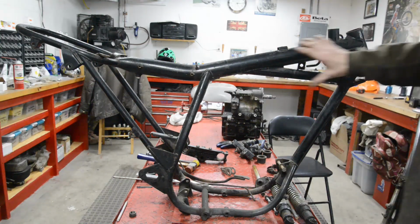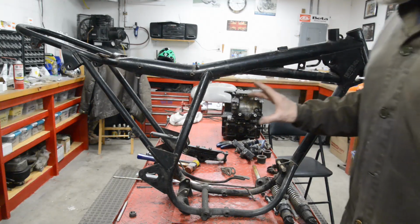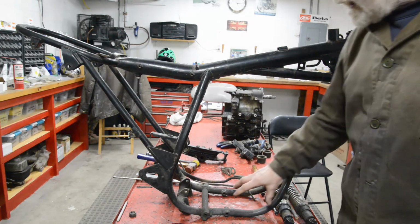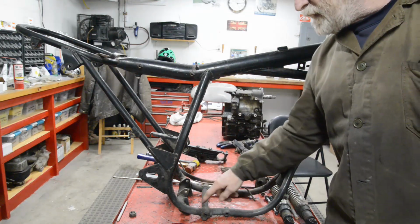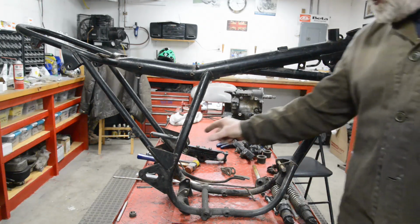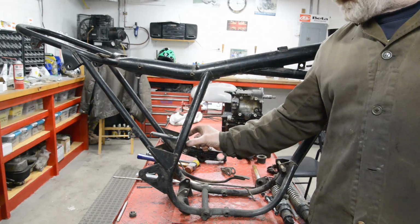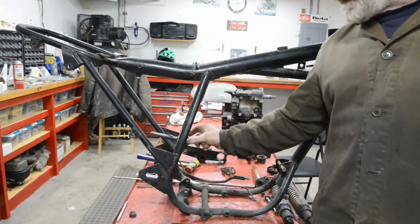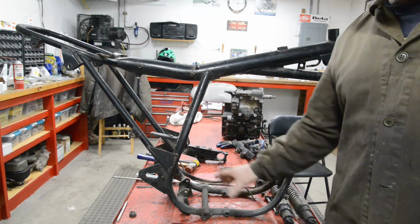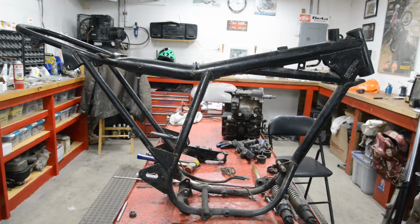Everything will be fine. So once we've got it all rebuilt rigidly, then we'll bring the engine to it, because as you saw at the beginning with the photographs of the XT500, we're going to have to drop the engine down a little bit, so these are going to have to come out. It's going to be a front engine mounting here. We're going to use this to take the mounting at the top of the Yamaha 650, and if we've got that in, and that in, then we can redo the bottom rails with the engine in situ, and we can do the bottom mounting. Everything will be nice and easy.